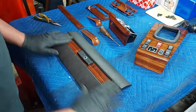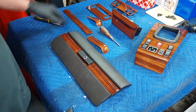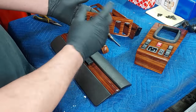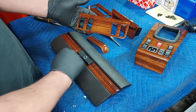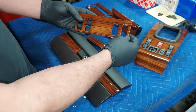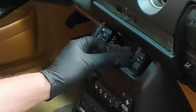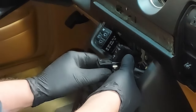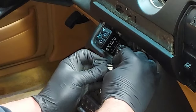Now I'll start with the upper center console — the dome light, wiper switches, rear glass heater — we're going to put all those switches through here and install this first. This is probably the most tedious part. I've got all my switches plugged in. Behind them there's a little fiber optic wire — that's where the light shines through to illuminate this. We're going to unplug these and feed the connectors through.